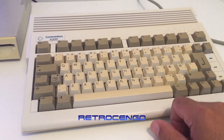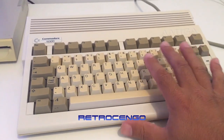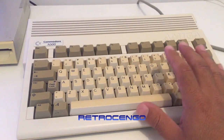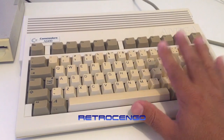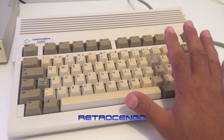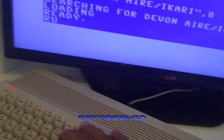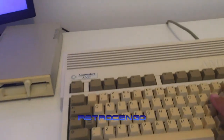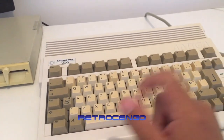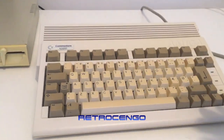He called and said he wants to buy an Amiga 600 and he wants to play WHDLoad games on it. We talked a bit and I told him about chip RAM - if you watch my videos, I love having two megabytes of chip RAM for WHDLoad gaming, it's just a must for me. I know one megabyte can probably also do it, but two megabytes is the way to go. We also need some fast RAM; some say four megabytes is enough, but I think eight megabytes is the way to go. So I told him I could build him an Amiga 600 and install a little accelerator card for more memory and a bit more speed to run WHDLoad games.